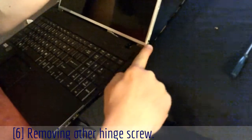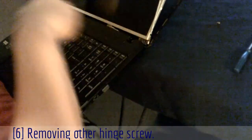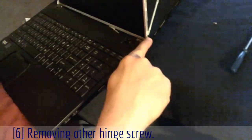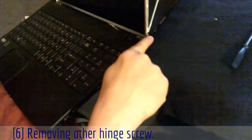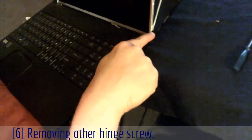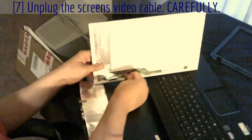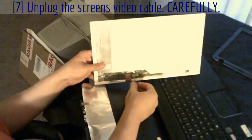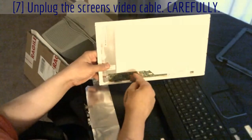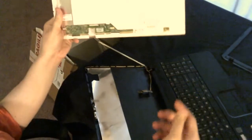So there's the screw we need to get to — which we can now access. You had to loosen this hinge piece on each side to separate it from the outer clamshell cover. This little black screw — there's one on the other side as well. Get that off and you're free. All you have left is a cable to unplug. Just wiggle it off — it may stick, so gently peel it off like a sticker. That's it. Now just do everything in reverse.